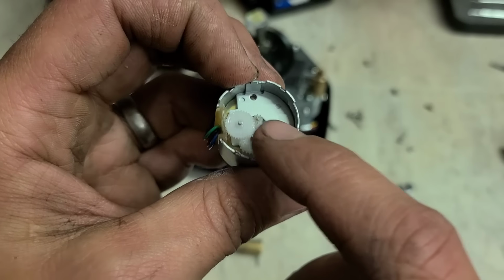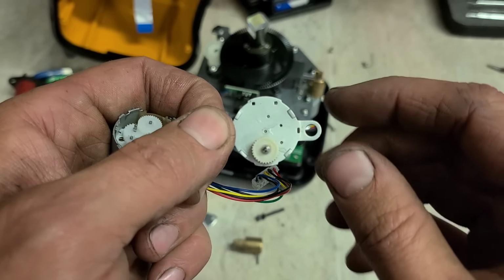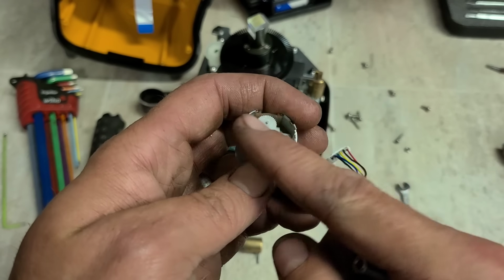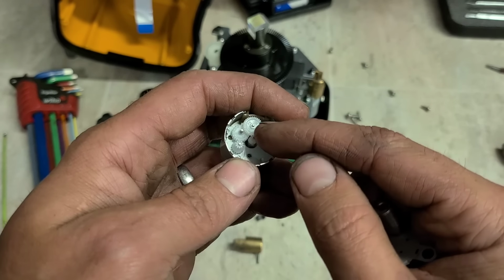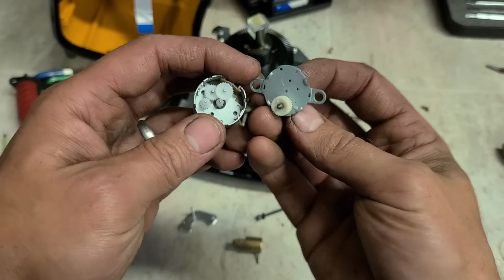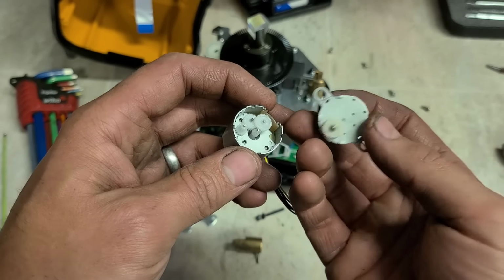You see these four gears, they're on pins. The pins actually locate into this metal cap. So if this isn't fixed correctly, these aren't fixed correctly, they're going to move and flex back and forth. So as the motor runs, feels any resistance, these can actually just move away from each other and start grinding and stripping instead of actually driving anything. So if I can fix this back on correctly, this should solve the problem.